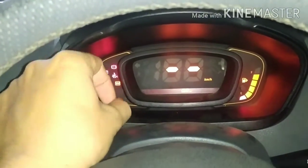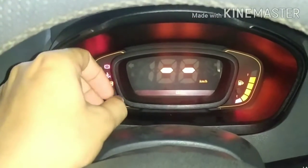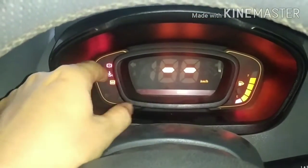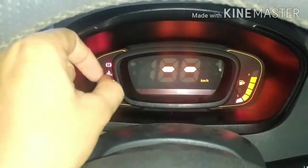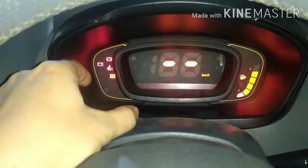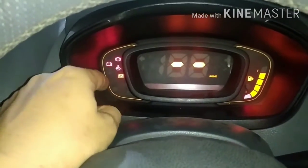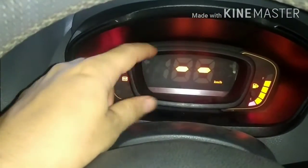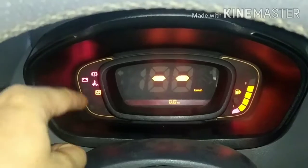Now about the accelerator pedal light — 90% of people think this is the accelerator pedal light. But this is not really the case. First of all, I will tell you that this light is not the accelerator pedal light. This light is actually the malfunction light — electrical malfunction. If you say it the right way, it means that in your car there is an electrical fault. There could be a fuse issue, the main fuse, the fuel pump relay, or if there is a sensor that is cut or faulty, it can also cause this light.